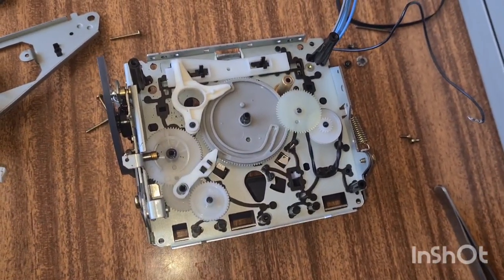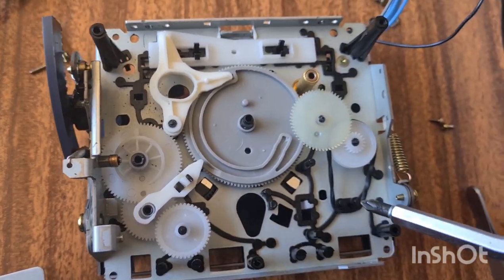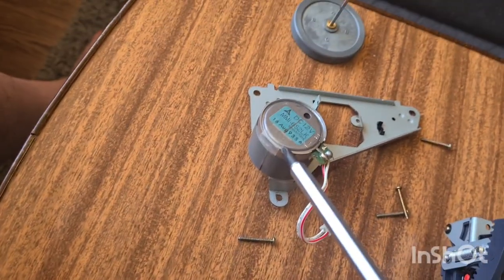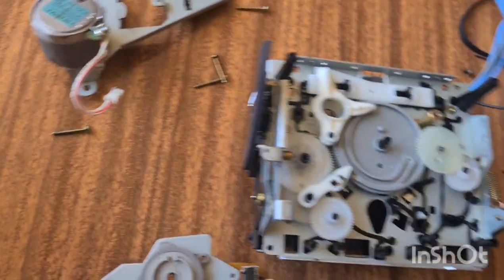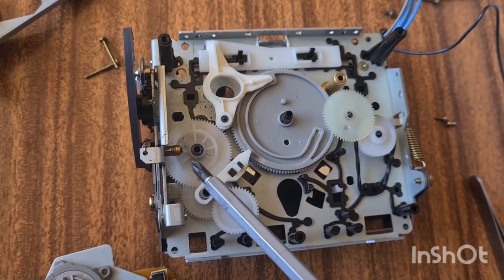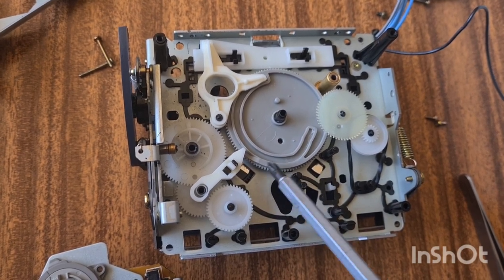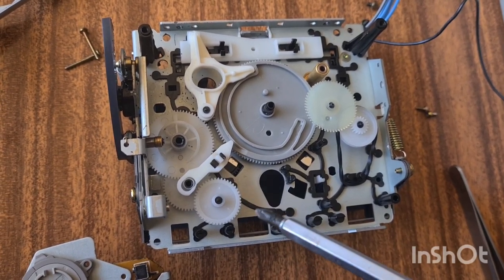This little belt on the side here latches onto your mode select motor, which is one of the two on here. I think this is what's called your backup motor, and this is your main motor, which goes onto your drive capstan. It drives all the time when it's plugged in, which is a bit odd, but it is what it is. This side of the mechanism controls the electronic eject — this arm latches onto another arm, and that interacts with the mode select wheel depending on where you are, to allow you to eject. So you can't eject halfway through playing when tape is inside the machine.